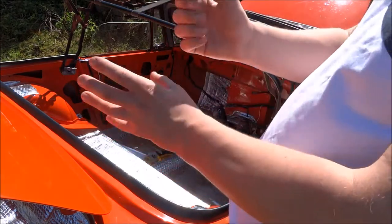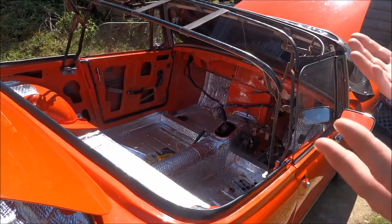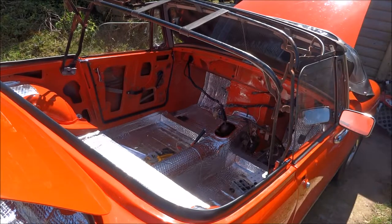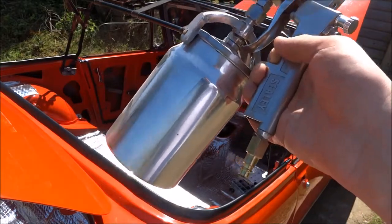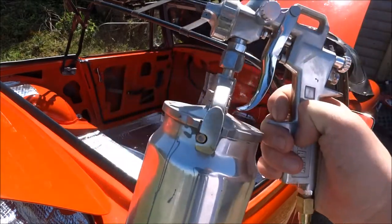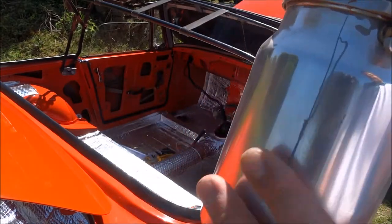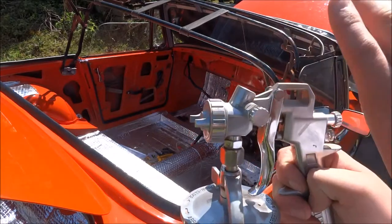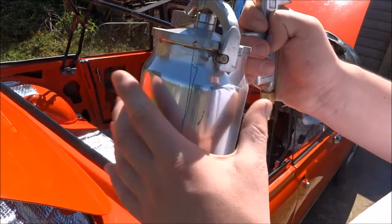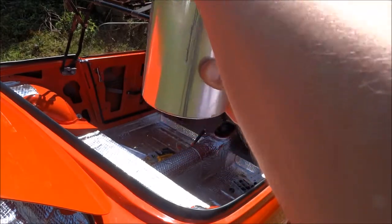But I used a base coat spray gun, which I'll show you now. That's perfectly good and it's highly recommended. It cost me about 35 quid from my local country store. So that was the base coat spray gun I've been using, through an air compressor. Easy to clean, and also the paint inside never ever sticks to the inner side, unlike you get with the ones with the plastic on the top. So the ones on the top are always a mess and a pain to do. This one's dead easy. It's literally just pull the pressure thing out, pull it out, and then it's in there.